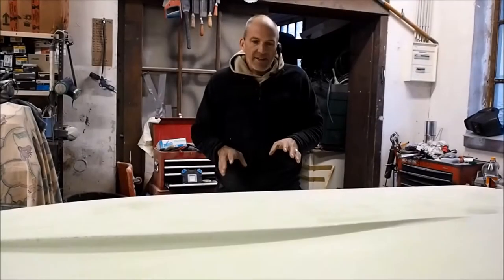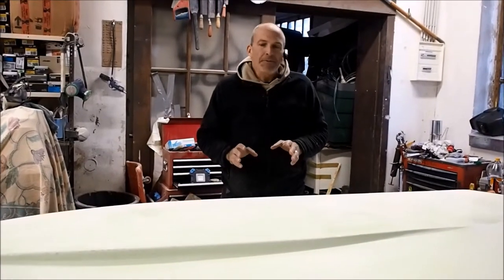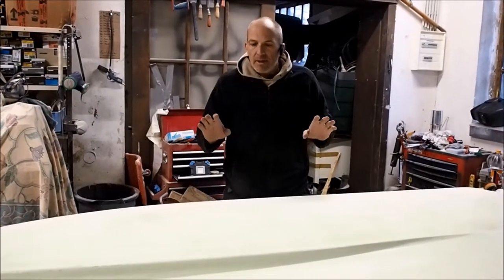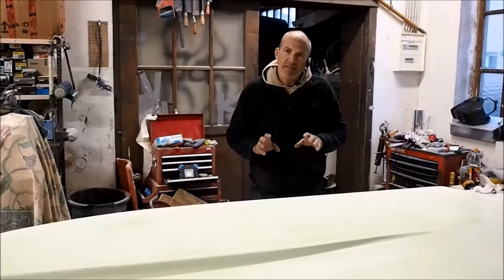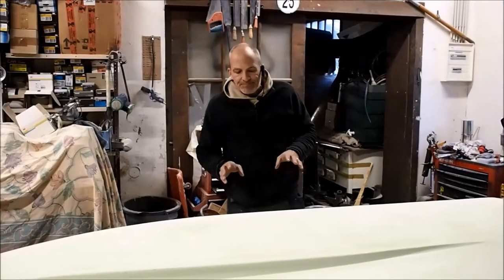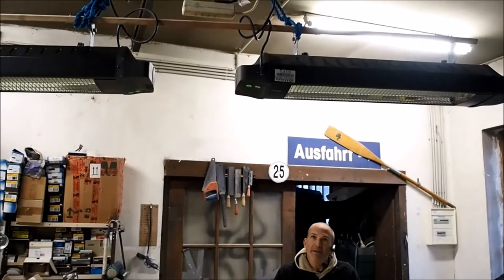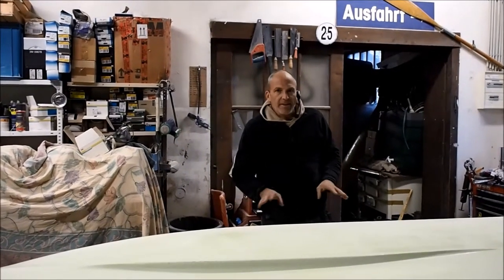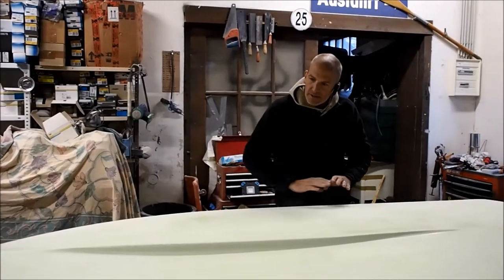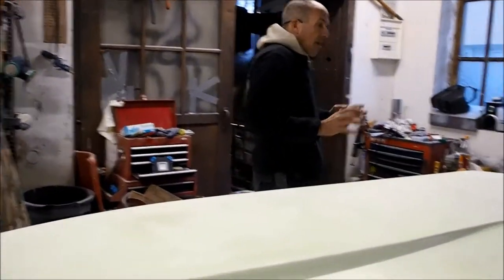All right, it's been a couple of days. As we were in Germany and it became pretty cold, the epoxy primer did not dry too well, so I had to wait a couple of days till it's really hard. As you can see, we have this nice construction on top there with the UV hardening lamps. Just switched them off right now because they interfere with the microphone. So now all good. Sanded it down today once more, so it's completely smooth. There was a couple of runners, I think I showed you last time. And now we're gonna paint.